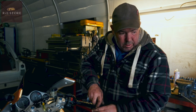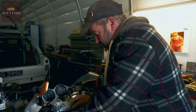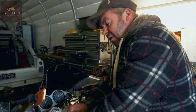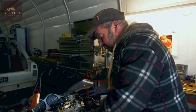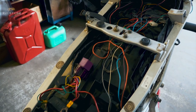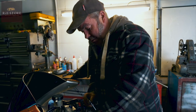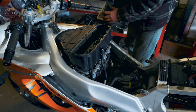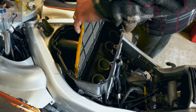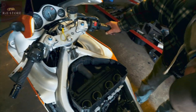All of these alarms are all good, but they cause normally more problems than anything else. They drain batteries. They're all wired in differently — you can get very basic ones or very complicated ones, and this one's obviously quite complicated, looking at all that lot. I've never understood people who do wiring and just make it messy. It's not hard — bit of tubing, a few clips. It's all been apart before. The cable ties around those shouldn't be cable ties — there should be proper clips. Get the air box out.